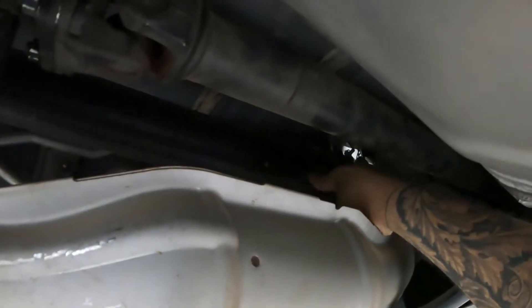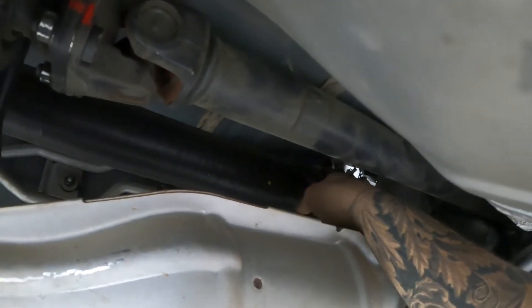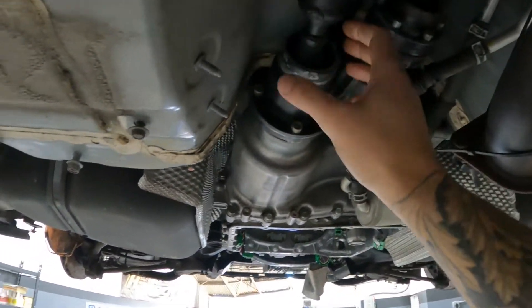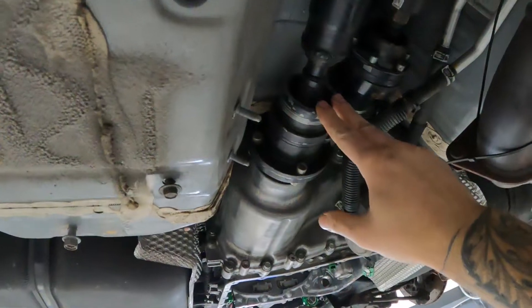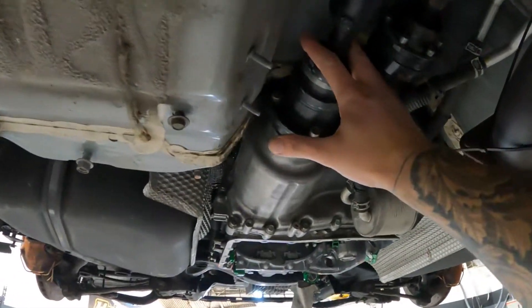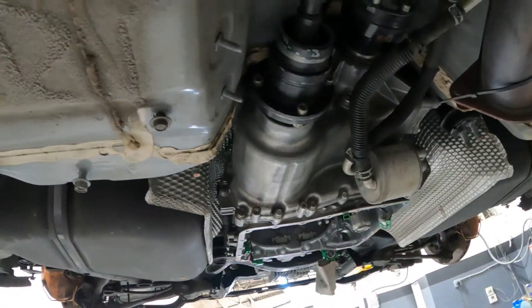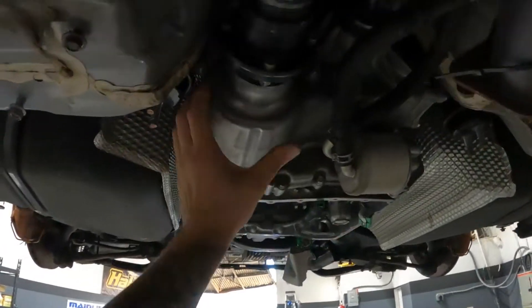There's a propeller shaft right here, and a bell housing right behind the engine with a flex plate. The shaft is always spinning as long as your engine is running, but the car itself doesn't move unless the clutches engage. The GT-R GR6 sends about 10% of its power to the front tires. On a stock car making around 400 wheel horsepower, that's about 35–40 horsepower to the front. On a car making 3,000 horsepower, it sends about 300 horsepower to the front — so you can see why this little unit gets super stressed out. A lot of guys do upgrades increasing the clutch capacity and aggression, and that's called the ETS unit.